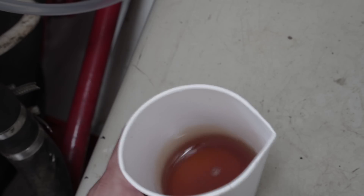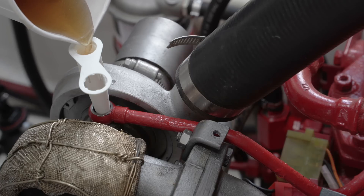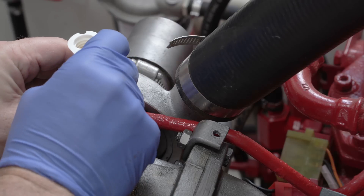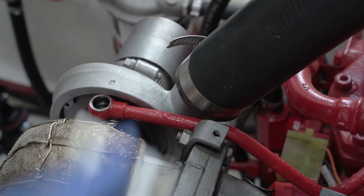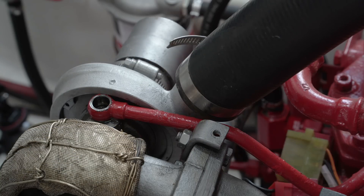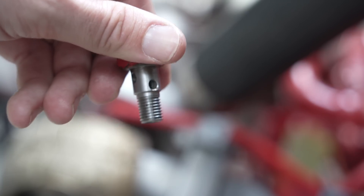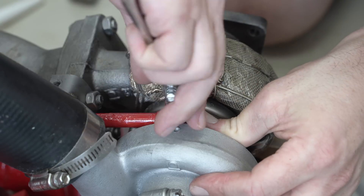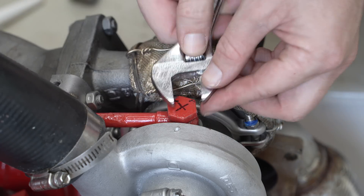Little did I know. My mini funnel seemed fine, and I decanted some oil into a cup, ready to carefully pour into the turbo. I poured — slowly I thought — but then panic. Oil left in the funnel, which meant I'd overfilled. I don't know whether manually turning the turbo would have drawn more oil through, but it only needed a few millilitres — I'd overestimated how much by about four times. So I resigned myself to an overflow and a clean-up job of oil dripping down the sides of the turbo. Anyway, I cheered myself up with the banjo bolt, the design and operation of which it turned out I completely misunderstood — I thought the two perpendicular holes in the shaft needed to be orientated, but I didn't realise these fittings allow flow regardless of orientation. Marking the hole directions on the top was unnecessary, and I could get the final quarter of a turn complete when tightening it up. I'll repaint the top and the oil supply pipe to hide the evidence of my overthinking the problem.